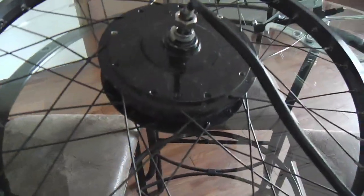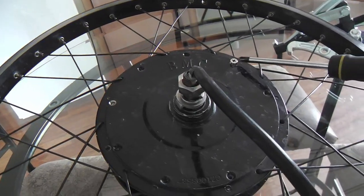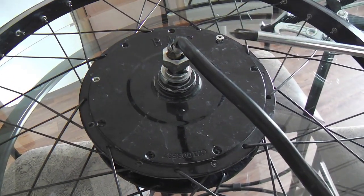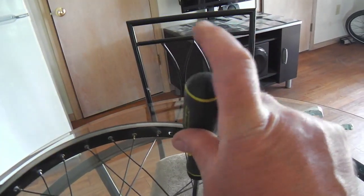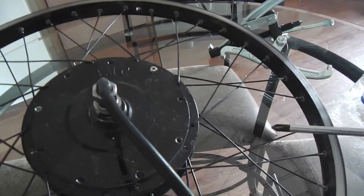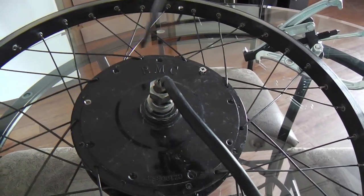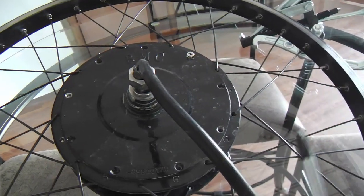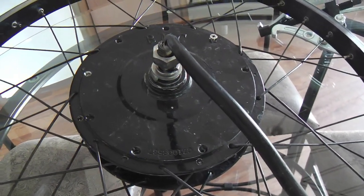Here we are about to take the cover off this hub. A couple of things to mention: these screws — I've been told and read on the forums — you've got to be careful not to strip them out. I picked the very best Phillips head screwdriver I had for these machine head screws, and I set them with a hammer tap to seat the screwdriver well and break them free. They were snug, but I don't think there was any real danger if you use the right screwdriver. Stripping those out is something you definitely wouldn't want — if one or more stripped out, you're stuck.